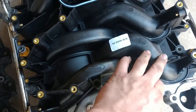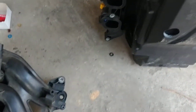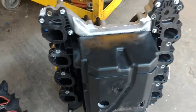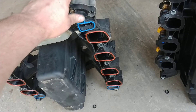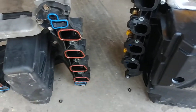The runners appear to be a little different on the Ford intake — maybe a little bigger. When we flip the intake up, the Ford intake has this big cover on the bottom, but even with the cover on you can tell the plenum underneath is way bigger than the Dorman's. I also don't like how Dorman does these gaskets. The Ford gaskets you put on the head, push them down, and they stay. Better design — the Dorman ones fall out.